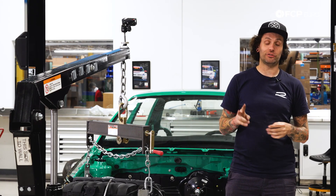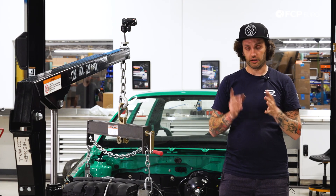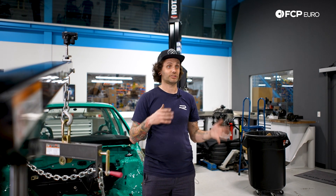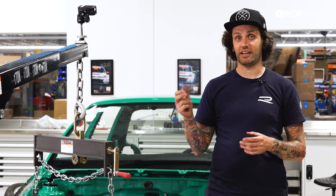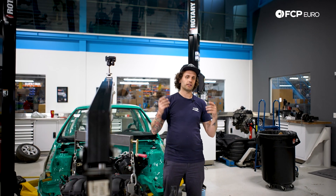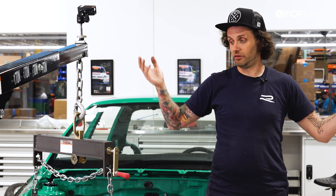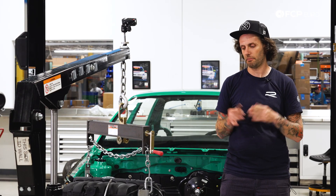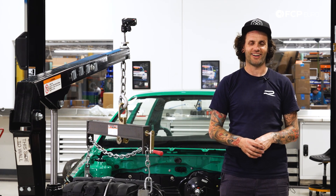It is 4pm on day two, which means we have now been working for about 32 hours in our 36-hour target. A lot of solutions found - got a new starter, worked out the spacers for the starter. The front motor mount bracket still doesn't have a solution, but we now have everything in place to develop that solution. Right now the engine's going back in for the second time. We'll bolt it in the two in the back, then I can work on modifying that front bracket. Once the motor's bolted in, suspension's in, brakes are bolted up, steering's bolted up - that's always been our target. I was hoping to get some of the wiring done, but there's always tomorrow at my own shop for that. Back to work.